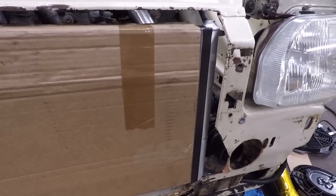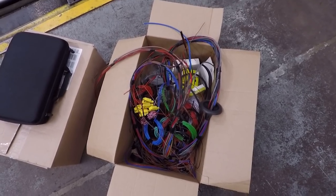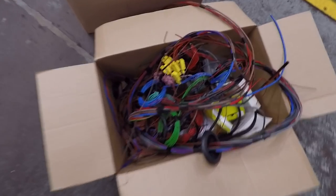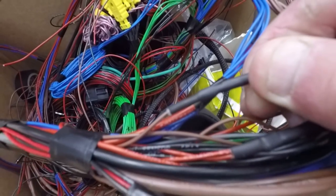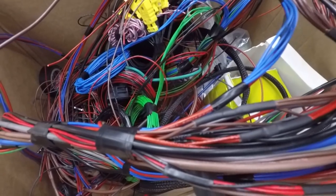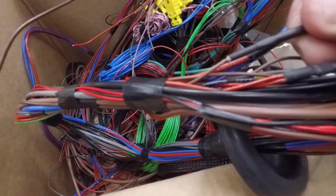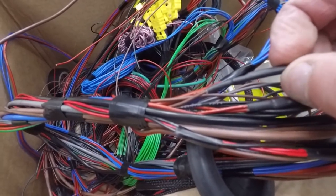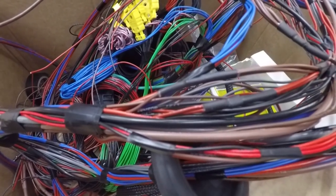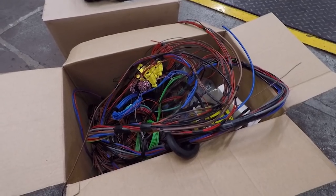Another job today is the loom - need to try and get this back in for a second fit. Last Sunday I got up really early and sorted out all my sensor grounds. I had to splice wires, so I used little open barrel butt crimp terminals, crimping essentially three ground wires into one wire, with adhesive-lined heat shrink for a good decent seal - no solder whatsoever.